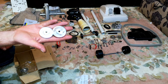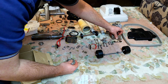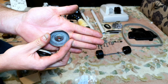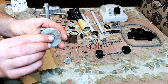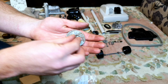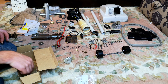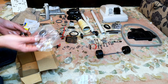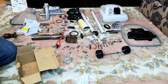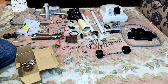I found these - very extravagant now - two brand new, never used end caps. Nothing really wrong with the old ones except perhaps this one which is quite dented, which would probably have been causing issues. This side I will keep because it's got a big dent in it - well, maybe I won't keep it. The problem is the inner bit breaks and spins around, so I have many of them. Then because we have a brand new front bearing, we may as well have a brand new rear bearing even though again there's nothing really wrong with the old one.